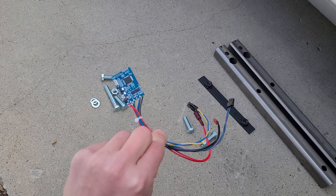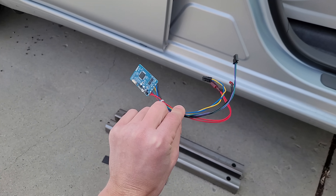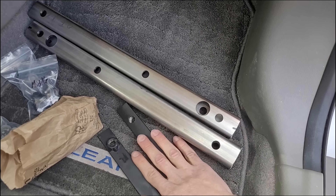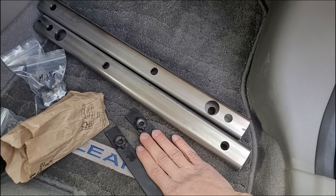I have all the extra hardware I need, and the last thing I have is my CAN bridge, already coated, flashed, and wired up. This is to essentially trick the car into thinking the new battery is okay so it will recognize it and operate properly. I'll put the link to Dallas's GitHub for the dimensions and how to make these metal parts.